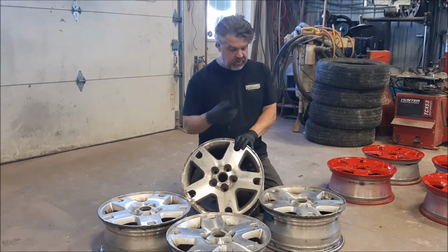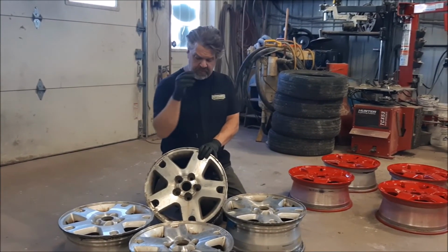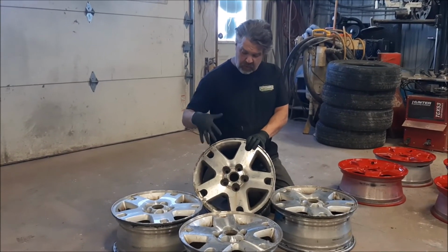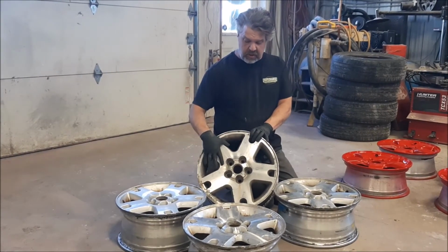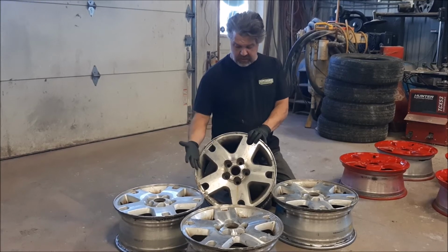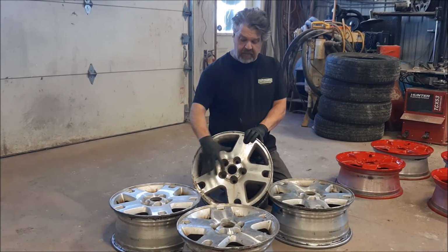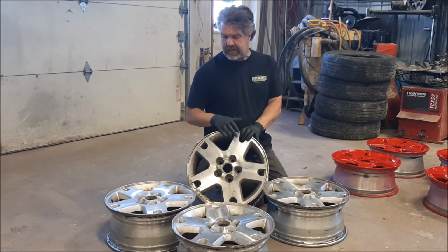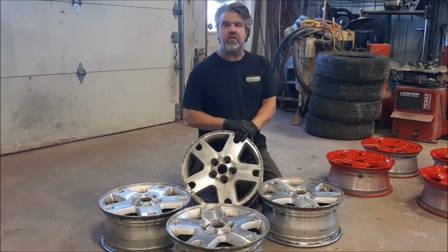So step one, we took the tires off. We have a state-of-the-art tire machine and balancer. We've taken the tires off, the valves and the weights. We're going to media blast them. Everything is done here in-house. We'll treat the wheel, put it in an oven to gas off and take all the gases and chemicals out of the alloy, and then we'll mask them and prepare them for a Bedliner coating. With these wheels, we're just going to do the normal black, and then we'll share with you what they look like throughout this process. So thank you for watching.